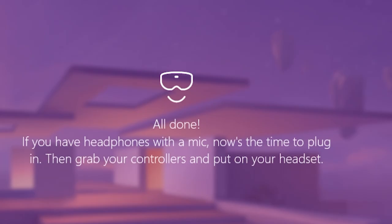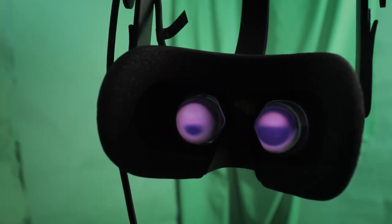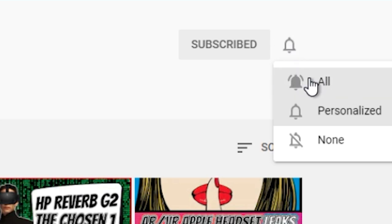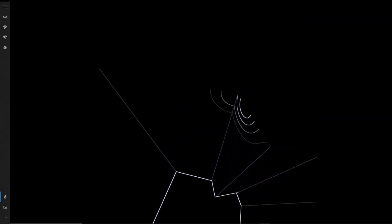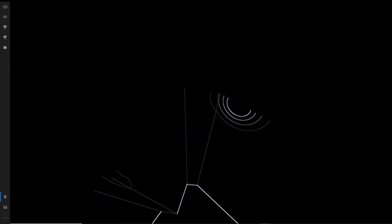After you put your headset on, one of two things will happen: you're either going to see a welcome screen asking you to click something to go to the next step — similar to what you saw on your PC — or you're going to see something completely black. If you see a dark screen, don't worry, it's absolutely normal for a lot of people. In the dark area, you should still be able to see your boundary. If your boundary seems too low, I'll show you how to adjust it in the next video. You can also extend your arms and you'll be able to see the limit of your boundary as you move around.